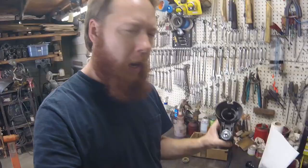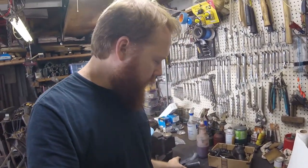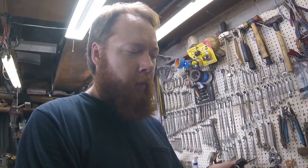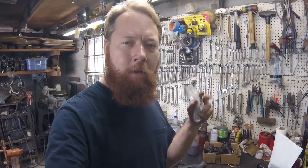Here's a little bit of a hang up. I need to get this ignition cylinder out of here and it's one of those locking dealies. Starting in — you guessed it — 1968. The model year of my car requires the key. I looked all over and found these, which I think were what was in it when I got this swap meet special, but neither one of them work. Got the trusty Samba up right now. This is why we follow up on these things — I would have probably caused a lot of damage trying to get this thing out. These are the kind of decisions that need to be made now and they need to be made well informed.